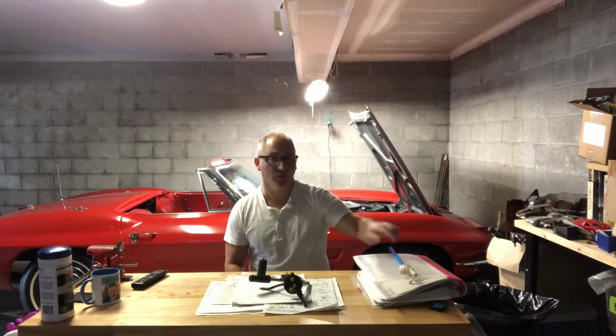Amp was fixed. So long story short, after a pretty long time with that 10 amp fuse burning out, it was just, as I described going through the forum discussion, one person who understood the needle in the haystack to say, get your eyes on this, because don't forget, there is a third harness in the rear that also will connect and have the ability to burn out that 10 amp at the top as well.